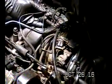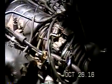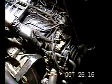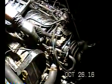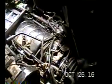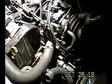So again, there's a V here, all right, on this thing. This one goes to the air check valve. This one goes into the throttle body. I can see where I'm going to forget that, so that's why I want to get this on the tape. All right, where this goes here. And of course, this is connected to all this stuff back here. But again, right here to the throttle body, other end here to the check valve. It's connected here at this V.